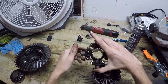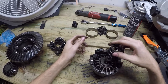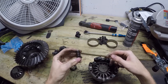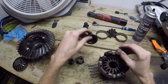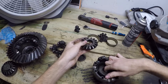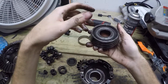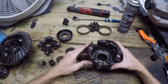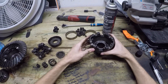These have to be spinning pretty well. These springs are going to be sitting in that little channel right here - there's a big one, a medium sized one, and then a really small one also. This little axle cap is facing up towards the spider gears, that's extremely important so don't mess that up. There's this other gear and then here's the next cone - this one is also destroyed just like the first one. I think this diff has over 200,000 miles on it and it's never been serviced, and the five previous owners obviously abused the car a good amount so it's kind of trashed.